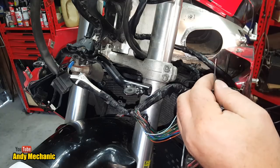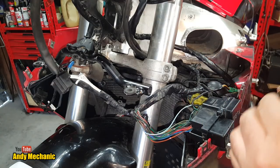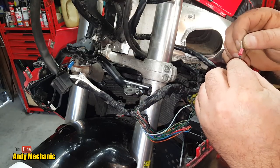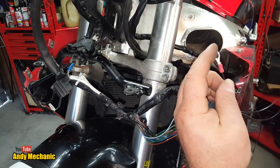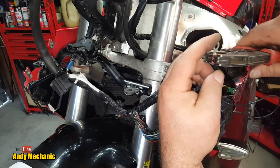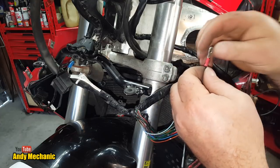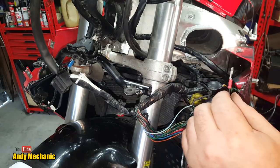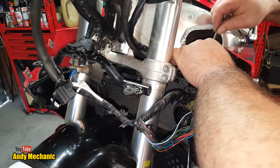Okay, so it's now a bit long, so we'll trim that down. There we go. Okay. Pop that in there. Get the crimpers. Choose the red one. Stick it on. Give it a crush. Take it off. Bob's your uncle. Okay, so I've got a bolt to undo. Stick this on, and then we can do a final test.